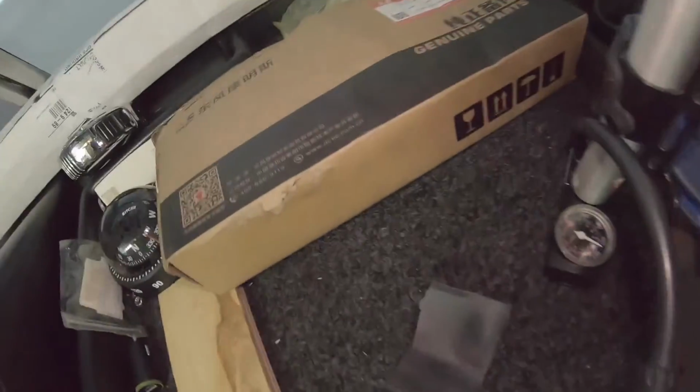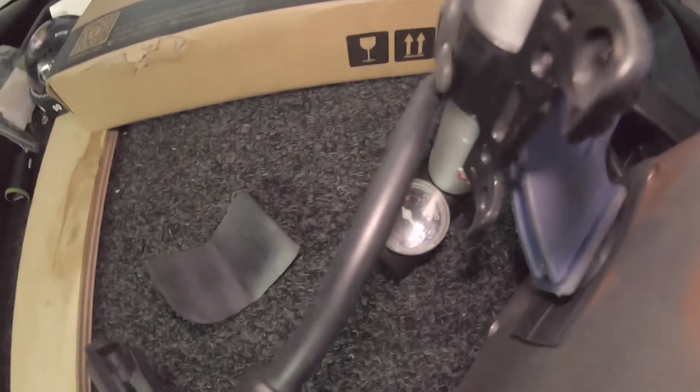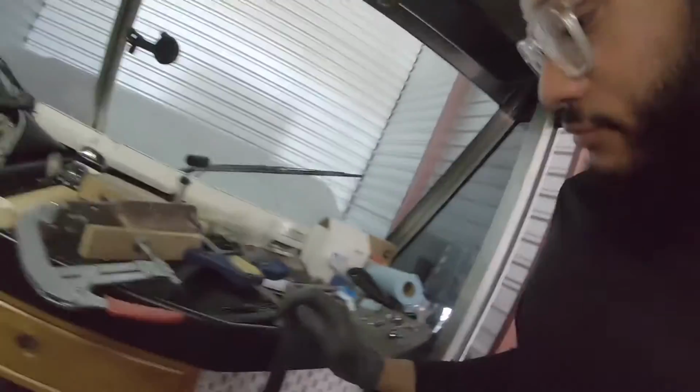And if you were testing your oil cooler for leaks, right now probably be a good time to check to make sure it's holding pressure. We are at 70 right here. So you get a good angle, pick that up. At 70, when I first started the pressure test, it was at 72. I dropped it down to 70, then I reset and I tightened up the clamps and everything. So that's where it was before I drained everything. So that's cool. That's good to go. Remove your filter, remove all your connectors, your hoses, everything that's going to interfere with removing that oil cooler.